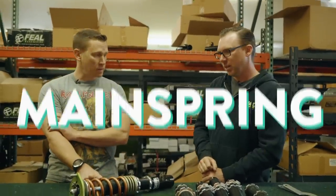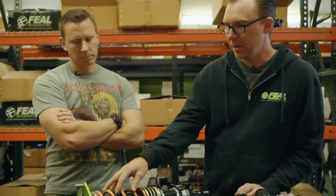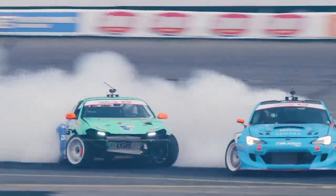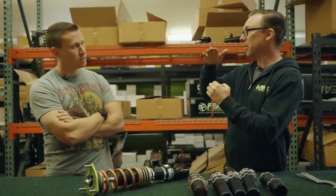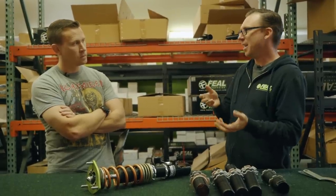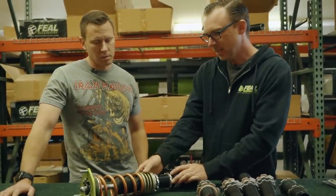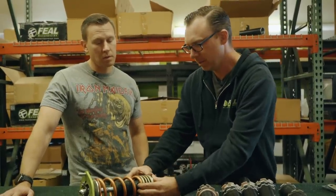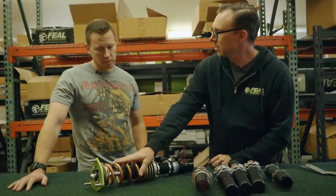We've got a helper spring and a main spring. The helper spring is very useful when the main spring is very stiff, because if the car hits a bump, compresses the shock, and on the upstroke wants to oscillate upward — if there's not enough mechanical movement left to go upward it'll top out the shock and probably lift the wheel off the ground. The helper spring is basically a placeholder: if you remove it, the main spring would jiggle around and not locate properly on the spring seats. This helper spring is so light you can literally compress it by hand — its whole point is to keep the main spring located in its correct place.